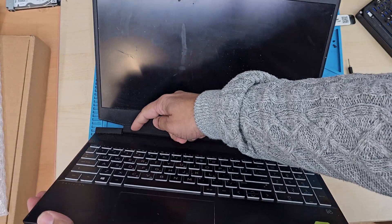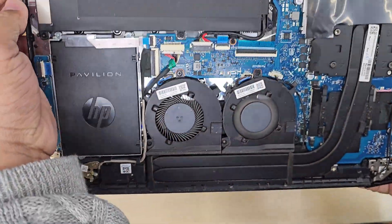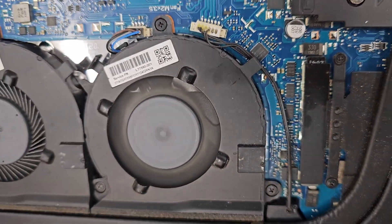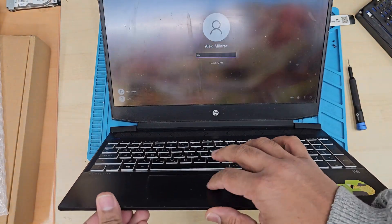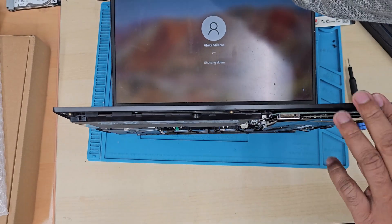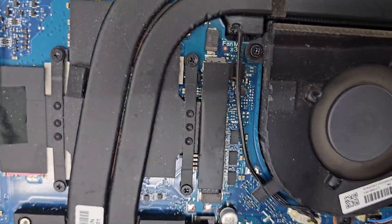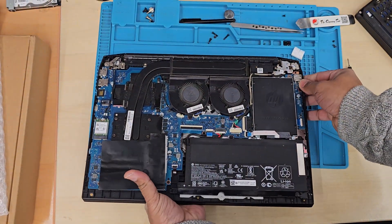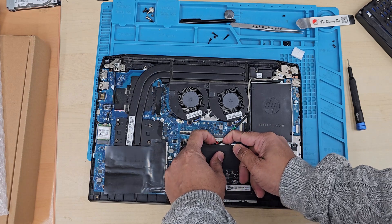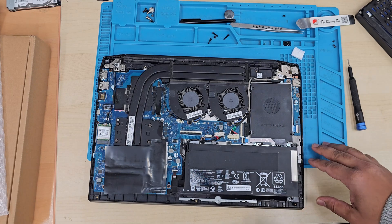I'm going to run the machine and see how the fans react. From the experiment, we found there is no bad noise from the CPU fan and the RPM was correct. At the same time, the GPU fan was not spinning because the GPU was not hot enough. To test both fans, go to the BIOS and change the fan settings to always on — when you do that, both fans will start spinning as soon as you turn on the machine. I don't want to take any risk, so I'm going to replace both fans to see if the problem gets resolved.